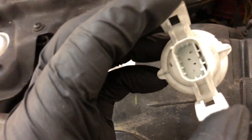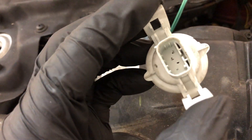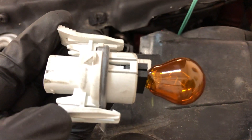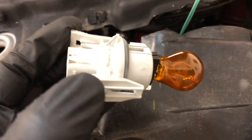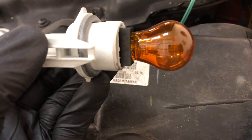This is the pre-facelift bulb holder — I don't have the part number off hand, but these headlights you can get on Amazon and they'll have the part number for the bulb holder in the description. You'll see there's a spot for four wires, though actually only three are in there — I assume a ground is shared. This has two filaments: a short one and a long one. The short one is the brighter-burning one, and the long one is for the parking lights on the pre-facelift cars.